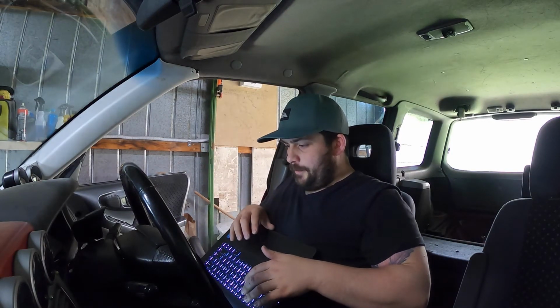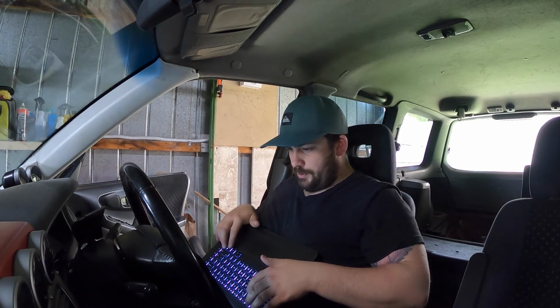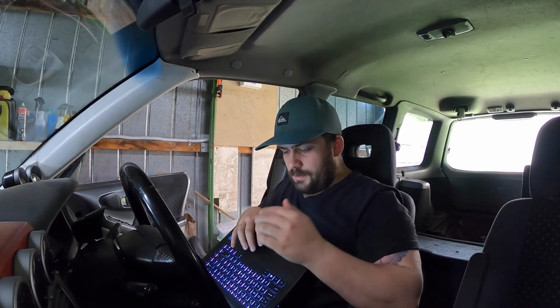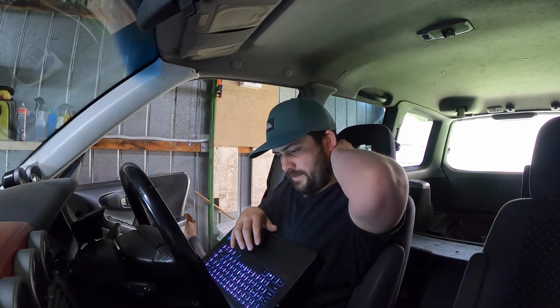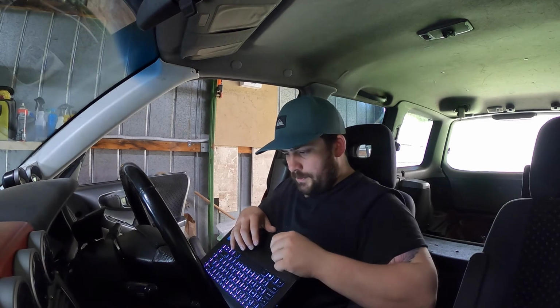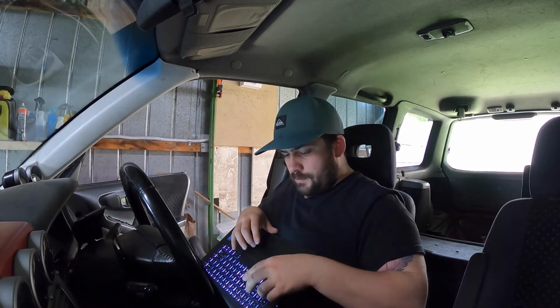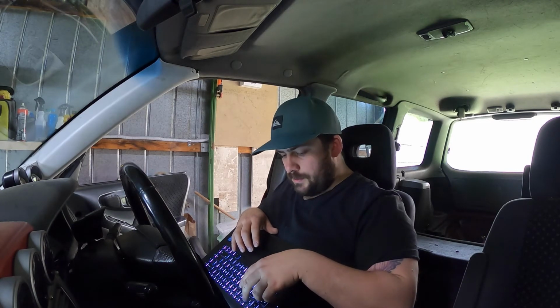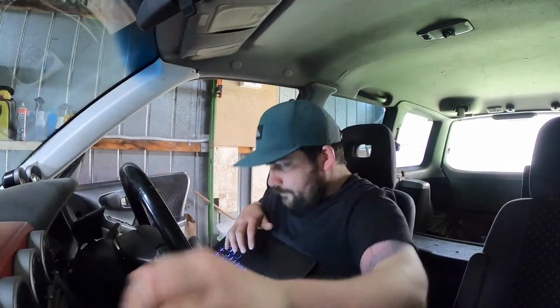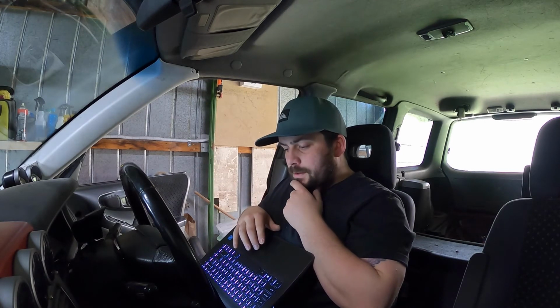Yeah, it looks like from the 2.38, where I've scaled it to, I need to add 5% to the rest of it. So I'll do that and see how we go. Trying to make sure that there's no fuel trims that go over into open loop.